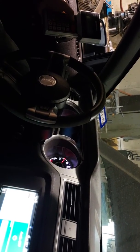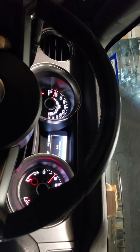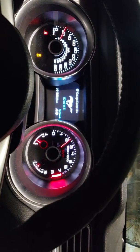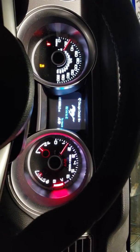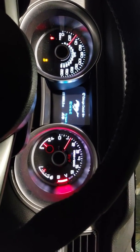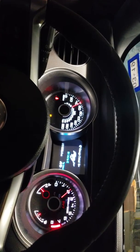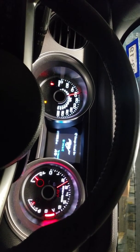Now that we're about to do the ramp test, I'm going to take it into fourth gear. It's important to get into a gear high enough to minimize the torque output to the shaft and maximize the efficiency of the eddy brakes. So I'm going to get into fourth gear in this particular vehicle. When I press go, the ramp will hold for 5 seconds.